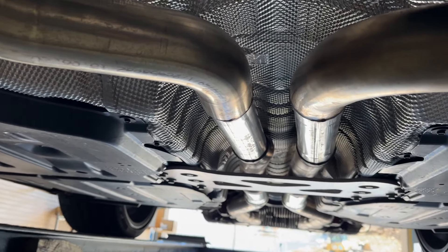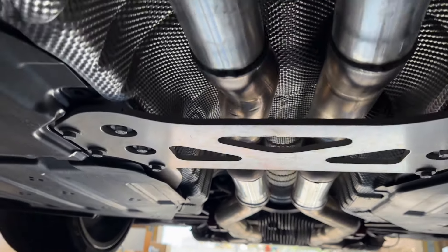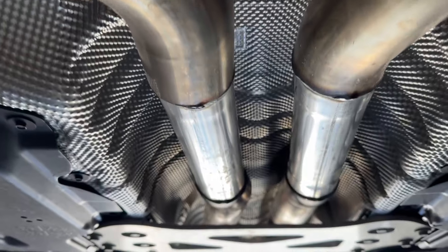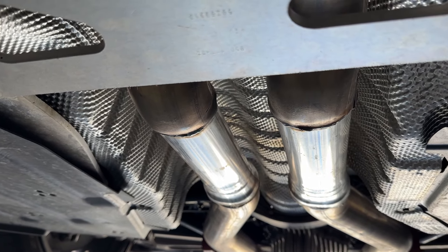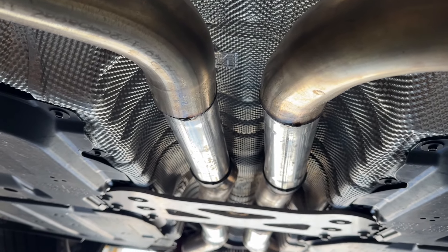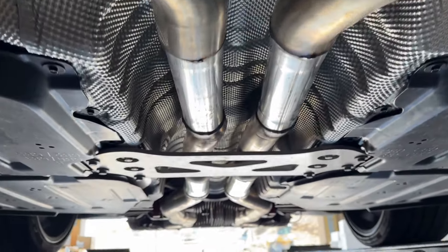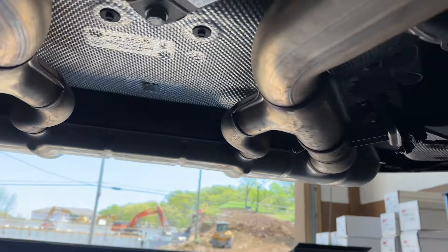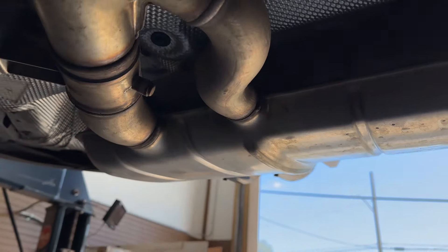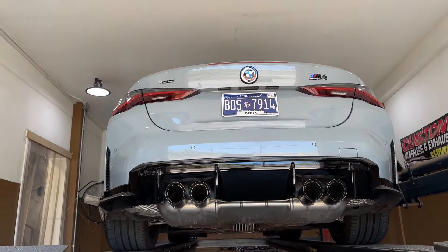Let me show you what we've done on it. It's got converters there and there — top converters. What we did is a mid-delete on both resonators. We deleted the mids right here and right there — double resonators deleted. This one is the X-pipe. The front one is a regular resonator, and the secondary is the resonated X-pipe. I'd recommend starting with the front one to see how you like the sound, then if you want it louder and more burble, take the second one off. He wanted more burble so we took both off. It's got a nice tune on it, valves tuned to stay open, stock muffler right there — it's massive — and some sexy black tips out the back that we didn't touch because they already look good. It is an M4 Competition.